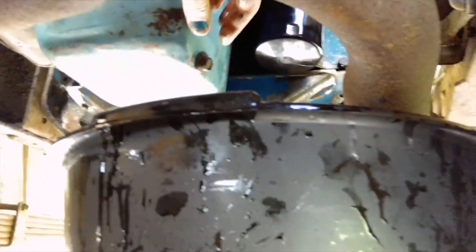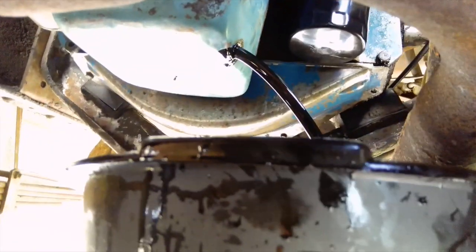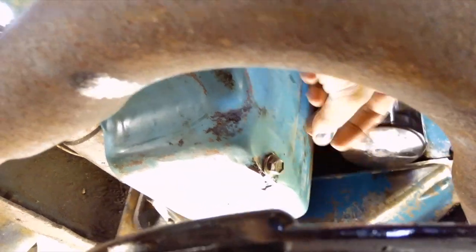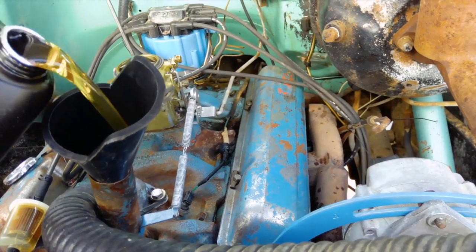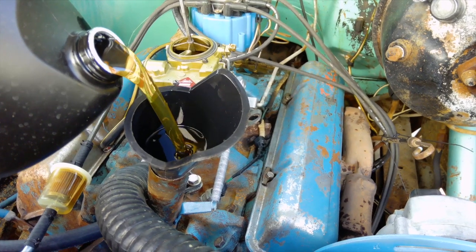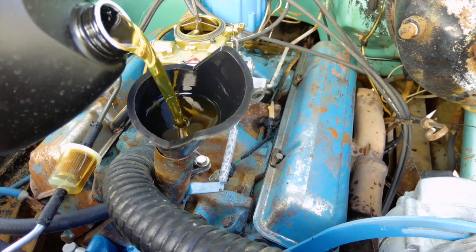We'll crack that loose. Set the pan up here — it's kind of a windy day and when you're draining oil the wind just makes a mess. I'm going to pop this drain plug out. Drain that oil. Once it's cooler we can get the drain plug in. I also put a new copper gasket on the drain plug instead of the nylon one. Plug in. There we go. Let's get some new oil in. This truck will be happy to get a nice clean oil change.